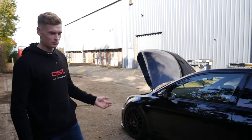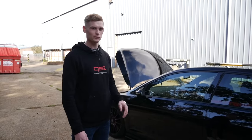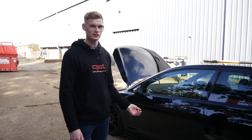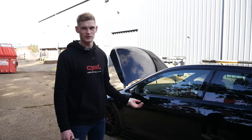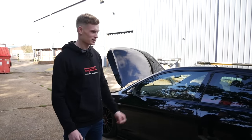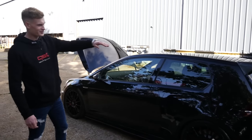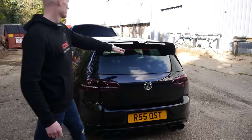Ecotune ECU software — Stan Ward at Ecotune does pretty much all of our big power calibrations for us, absolutely brilliant tuner. We recently signed on with TVS Engineering — they are the world leader in DSG software. So it's running a custom TVS Stage 3 TCU tune. The TVS software is just unreal, it's out of this world. The DQ250 is so, so fast now — you've got AMAX mode and Sport mode. The gear change is incredible. Exterior-wise, carbon aero kit on it, carbon mirrors, debadged on the back — hopefully people just think it's a 1.2 Golf with a big exhaust on it. No rear wiper, QST branding.